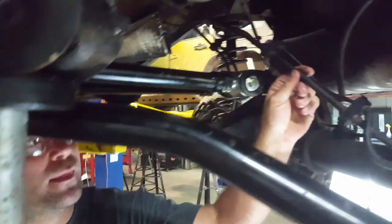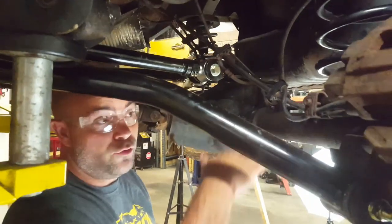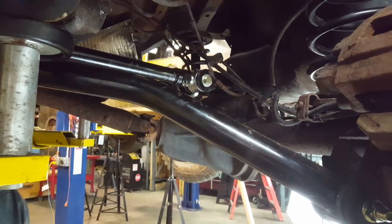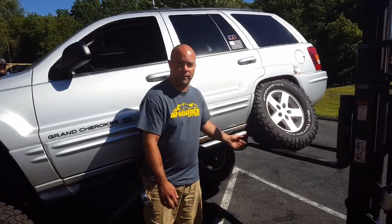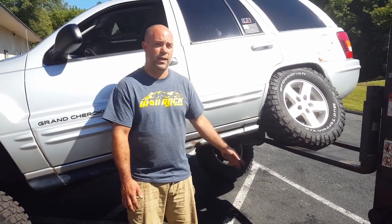Double-check that your e-brake cables, ABS wires, brake hose, and breather tube are all long enough. With the axle at full droop — hanging by the shocks alone — that is your worst-case scenario for all of these items; as long as you have clearance right now, you'll have clearance on the trail. We flexed it out with the forklift — we love doing this every time we install a new long arm kit. It's about 32 inches off the ground and the only thing holding this Jeep back is the length of the shocks; at about 4 inches of lift height, some longer shocks would get a lot more flex.